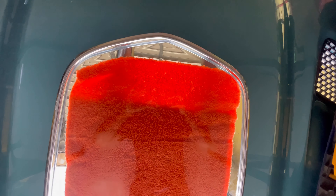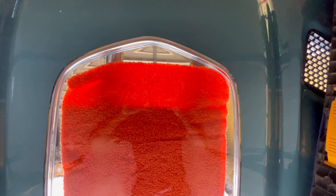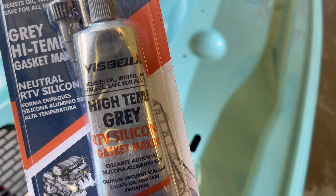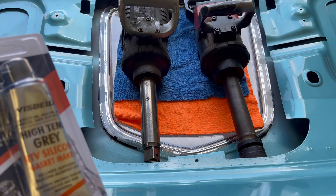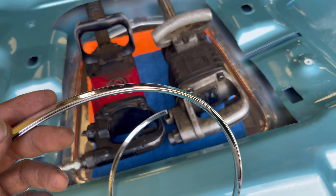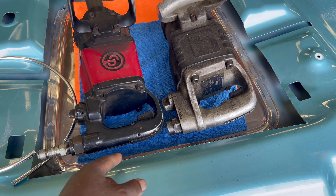Here's a view from up under the hood, sitting on the table — everything looking good, you don't see any glue. We're going to let it sit for a few hours, then flip it over. Also, you want to go ahead and put the high-temp silicone around it — the silicone is going to be drying on. If it does come with the kit, this is the only thing that comes with it; you have to buy the glue yourself. Take this remaining trim and put it along the back part — that's the part you'll be able to see once the hood is on the car.